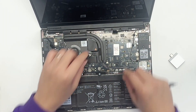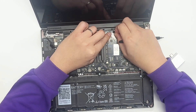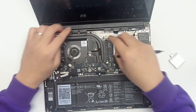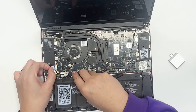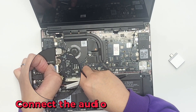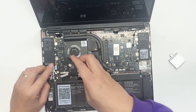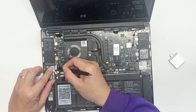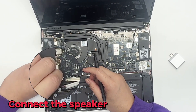Make sure we put the power connector in last — first out, last in for the power connector. So we put this connector in, then another connector. Then the audio jack — make sure using the screwdriver you seat the flap properly. And then the audio speakers.